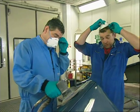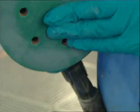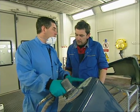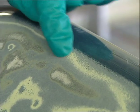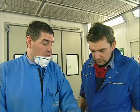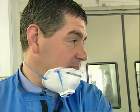I've put the panel back on, we've sorted out the dents, and we're now taking off the paint layers over where we're going to put on some filler. This thing's a DA — dual action sander — which means you've got a circular motion but it's also oscillating, orbiting at the same time, so you get a nice cross cut. To start off removing the paint, we're going with 80 grit because we don't need anything coarser than that to remove paint quickly. Then we'll feather that out with 180 grit and finish again with 320 grit.